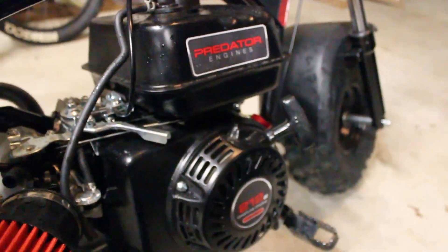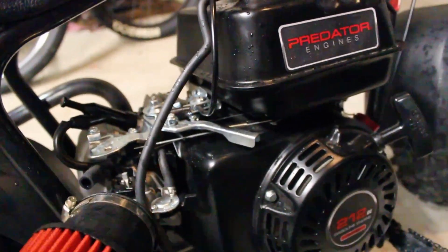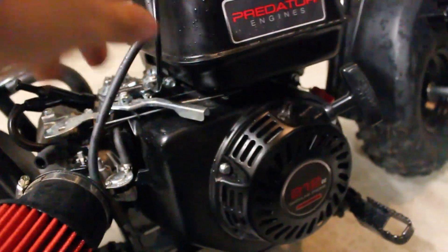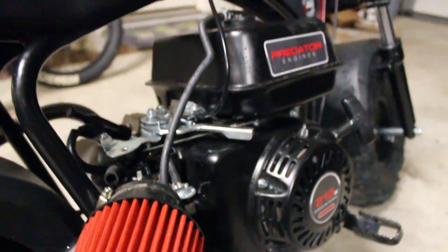After you unbolt the old one, you pull it out and take off whatever old twist grip was on there. Because I had an electric twist grip, so I had to change the twist grip. Then you drop in your Predator and just mark it up with Sharpies — like a white Sharpie or paint Sharpie. Put it through the engine hole, mark up the plate, drill the holes, find some bolts that fit, put them through. Or you could use the originals if you had an 80cc motor.